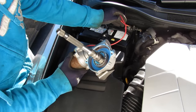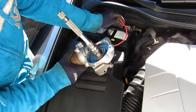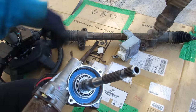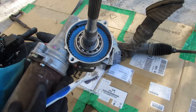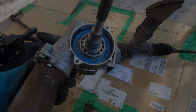Connecting this motor to 12 volts, you can see how it spins — it has quite a bit of torque but doesn't spin that fast. Ideally you wouldn't want this motor to spin too fast, and they've achieved that using this gear ratio. There's also the gear ratio on the steering rack from the pinion to the rack itself, because you need more torque to actually turn the wheels as opposed to a really quick steering ratio that could cause the car to handle twitchy.